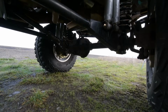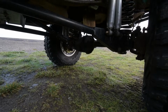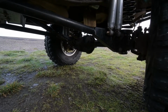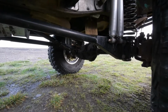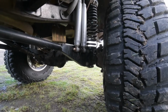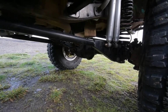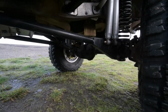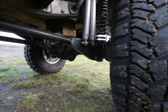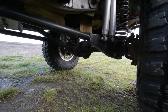Leave a comment. If we get down low, I was saying I'm running the stock Bronco axles. So this is a Dana 44 from a 71.5 to 70, I think 75, 76. But yeah, this is just your run-of-the-mill early Bronco housing. I'm running your typical disc brake kit and the Chevy knuckle kit from one of the vendors. So that has the smaller opening. I would run RCVs, but it's really tricky to get the RCVs into the housing with that disc brake kit, so I'm not going to run that.